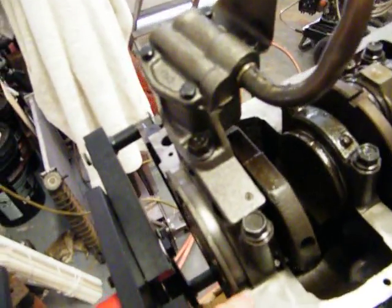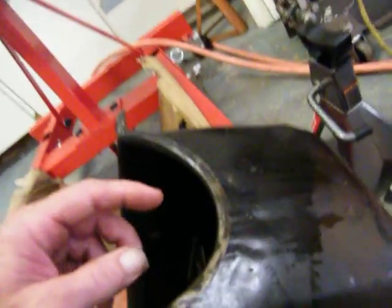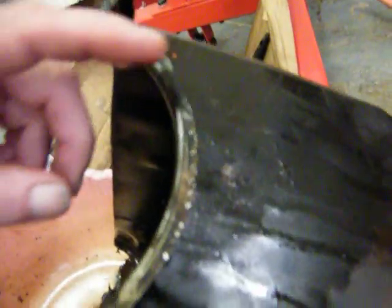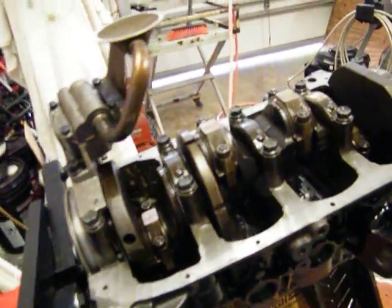The very important thing is to make sure these are extremely clean. I took the time to clean out the caps really well because that's where my rear seal is going to sit for the oil pan. I'll take the die grinder and buff that down because I don't want it causing a problem seating up against anything. We'll make sure everything is right.